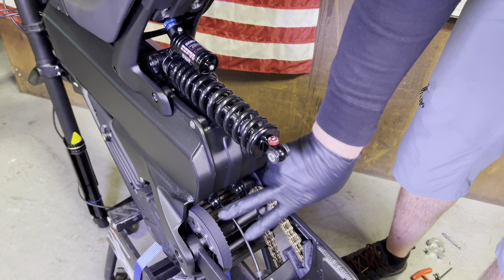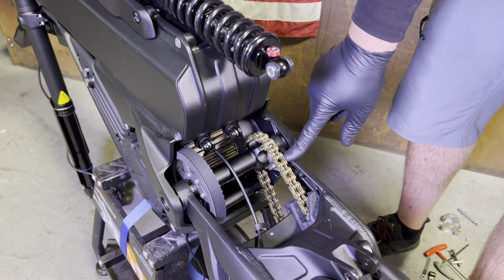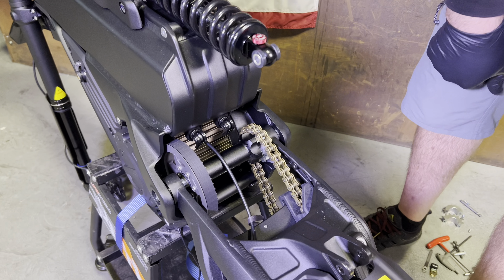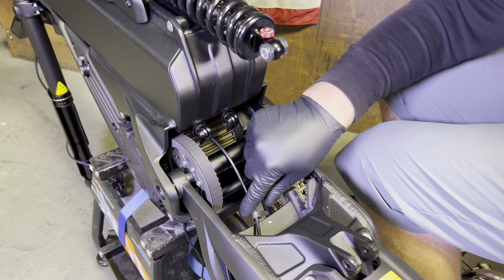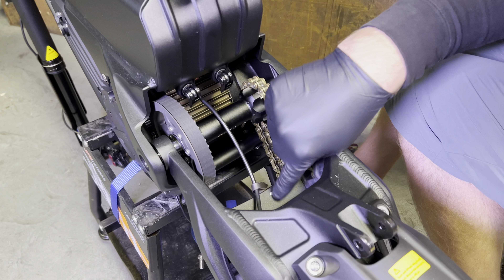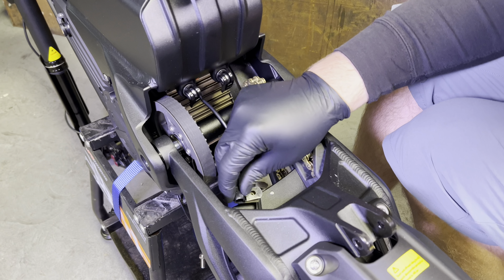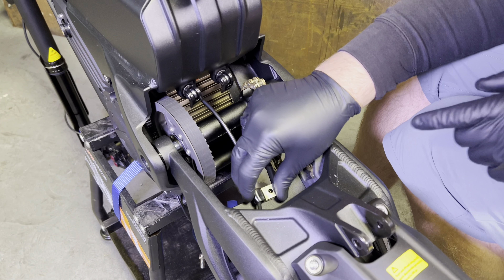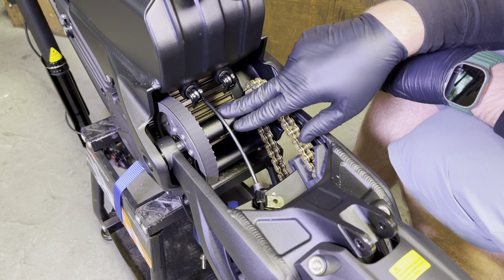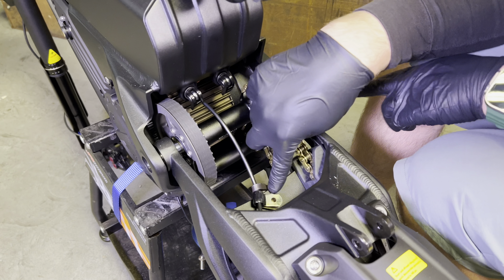Some bikes will have a plastic cover over the jack shaft — mostly the red ones. If it does have a plastic cover you will need to remove it; there are two little screws here and one screw here. That little cover is not compatible with the pedal kit. You also want to check — most bikes will have a little brake hose guide already installed, but for bikes that don't, they include a little hose guide bracket. You are installing a little cog on the jack shaft, so you need to be sure your rear brake hose doesn't touch that.